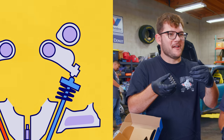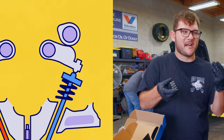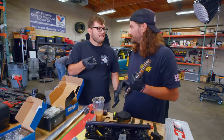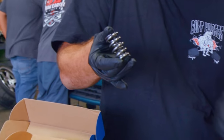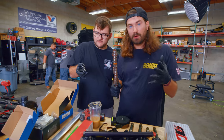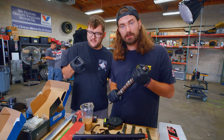If you're at those high revs, it floats, so you need a stronger spring to push it back into place. Then you can get into those crazy 9,000 to 10,000 RPM numbers — if you have enough valve spring. We're gonna have a double spring setup here and that'll keep our valves closing consistently at really high RPMs.